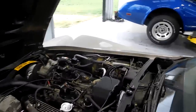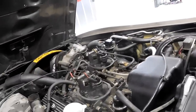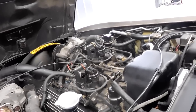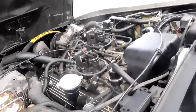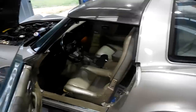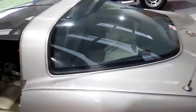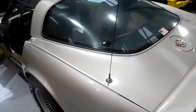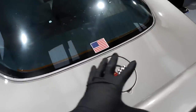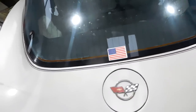We're gonna start with diagnosing fuel, make sure it's getting fuel. Let's see what happens. Okay, key's on, nothing, not a single thing of gas. So there is no fuel. So we're getting no fuel to the injectors. So that's gonna either be a fuse, a relay, or a fuel pump. So we're gonna remove this. We're gonna get access to the fuel pump and check it out.